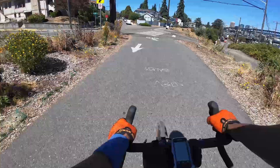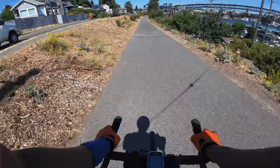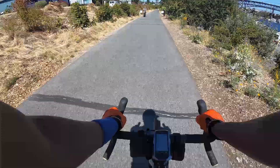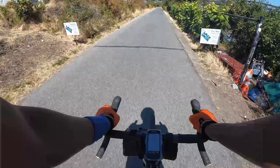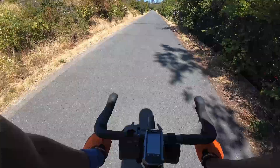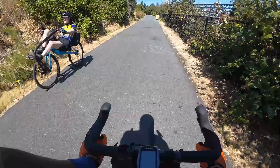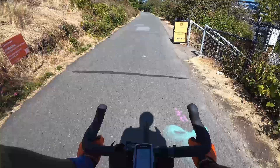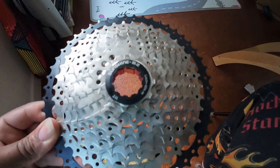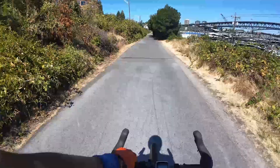On my bikes, I always try to get my climbing gear ratio below one, because I live in such a hilly area. I try to get it at least 0.8 or so, and I'll feel comfortable that I can ride all the places I used to ride without sacrificing anything. If you live in a flat area, you may not need a gear ratio as low as one — you might prefer a bigger chainring up front or a smaller cassette with tighter spacing. If you live in a hilly area like me, you might want that dinner-plate cassette at the back or a two-by system that can accommodate a wide range of gears to maintain some speed on the flats while still getting up steady inclines.